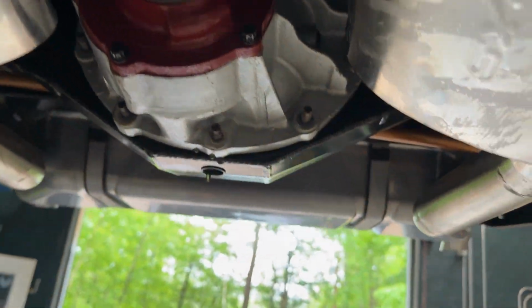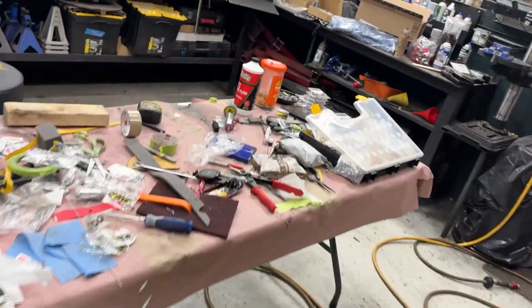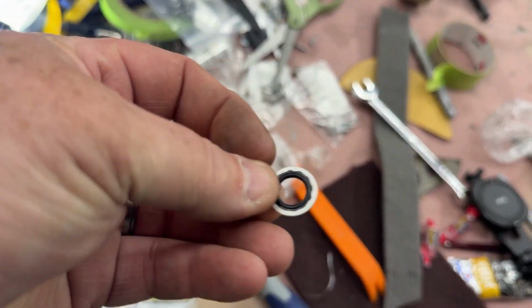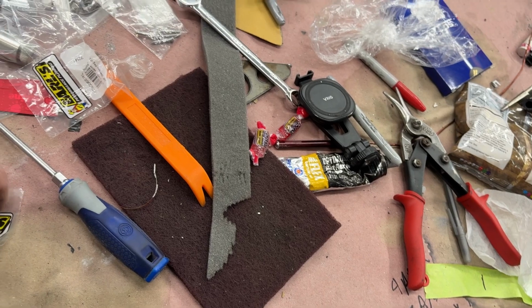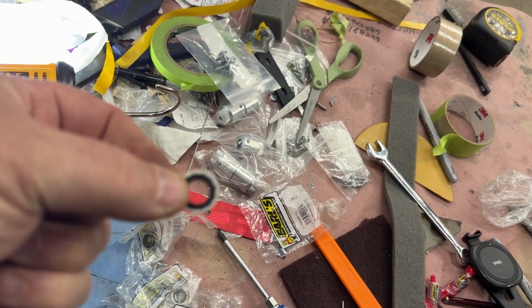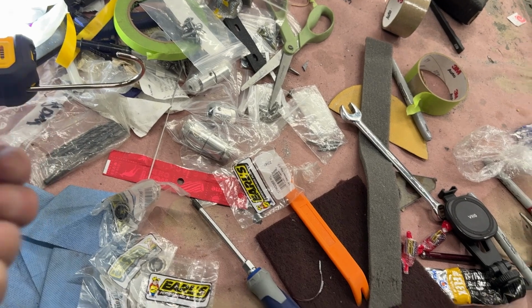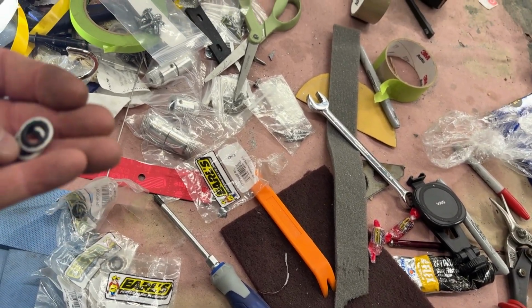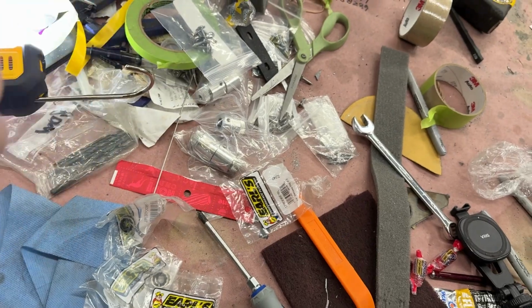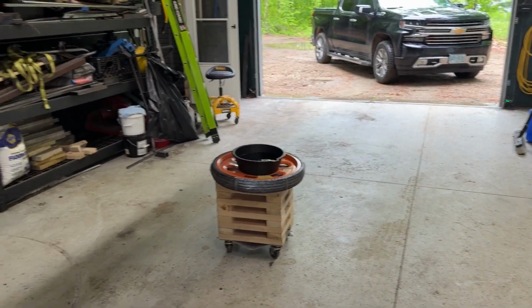and now I'm going to put on a sealing washer. So that's these little guys right here. And I'm going to put one of these on each bolt, covered over by the regular washer, which is just a flat washer, and torque it all back down. But the idea being that that will seal around that bolt nicely, and now it can't leak. So I'll show you how this goes together here in a second. Let me set up on the tripod and we'll get going.